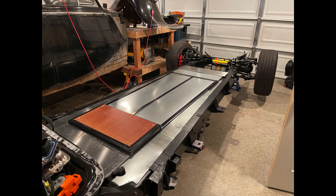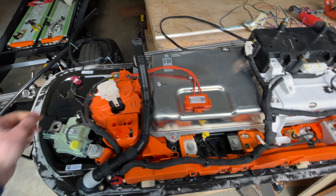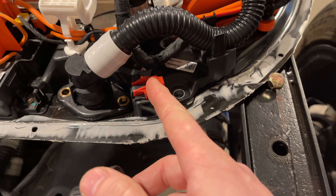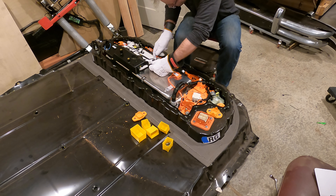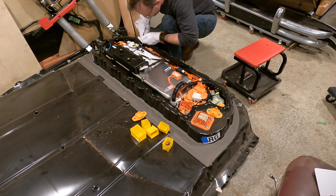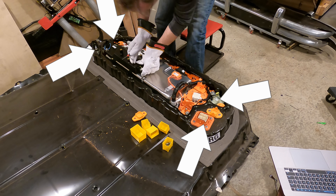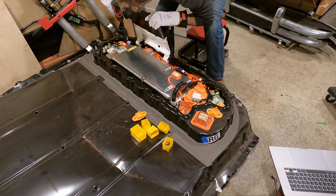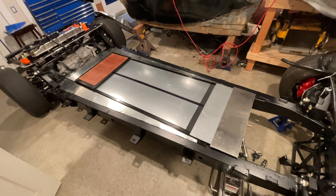I hope this all works, but I'm a little worried it won't. I'm worried there's going to be some sort of error due to the fact that I ripped the battery's guts out and stuffed them back in a different way. The battery controller is going to be like — something's not right, but I'm not going to tell you what it is, you have to guess. It might be a broken sensor, not enough resistance somewhere, or those sensors in the back that might be moisture sensors giving weird feedback. It's not really a deal breaker if I can't figure it out because the battery will still work as a battery — I can still put electricity in and pull electricity out. What I might lose is the charger, the DC-DC, control of the contactors, the safety system that blows the pyrofuse, and the battery balancing. I might be able to get some of those systems working, or I can buy aftermarket systems. Plan A, however, is to get this all working so it still thinks it's in a Tesla Model 3 and everything is fine. We'll see what happens when I get it all connected and booted up.